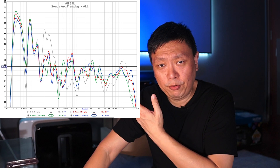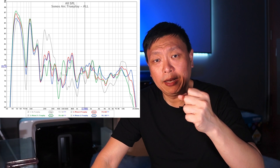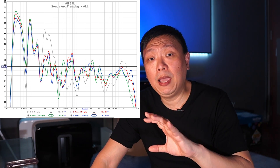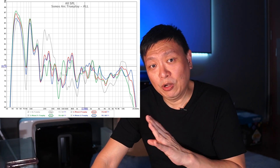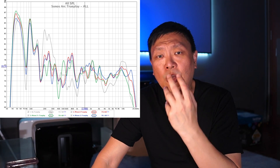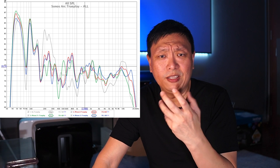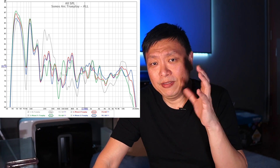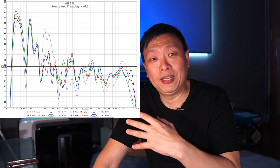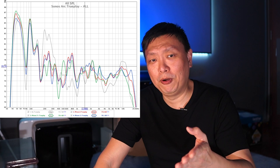Having seen all three frequency response curves, my preference is for the tune done with an iPhone 6. It enhances the bass, pulls back the human voice a little, peaks the mid-range, but tames the treble reasonably. I'd avoid the iPhone 7 completely, because it introduces a strange dip at 400Hz and a strange peak at 500Hz, and completely removes the treble end, making music sound very dull. While many have said newer iPhones render a TruePlay tune that is overly bright, I actually think it's perfectly fine for movie soundtracks. If the high-end treble irritates you, find an iPhone 6 to perform TruePlay, and problem solved.